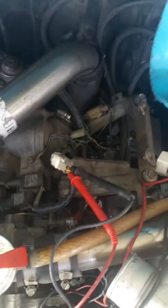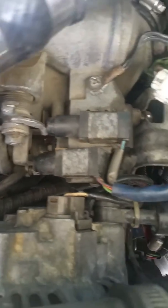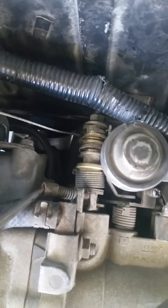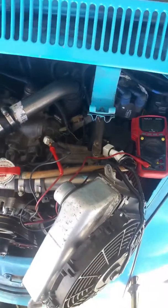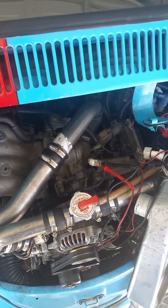And if you need to adjust anything, you've got a throttle screw right next to the sensors, and then an idle screw up here where the coolant preheater hose for the throttle body is. You can play with both of those, and you will hear the idle of the car change from erratic to pretty smooth.